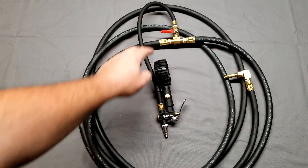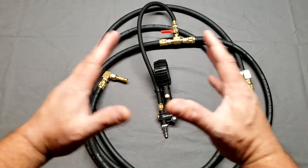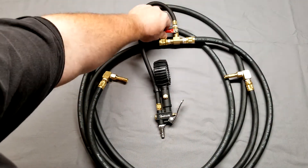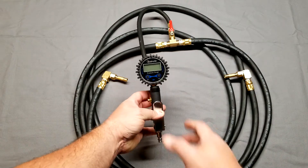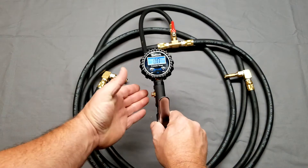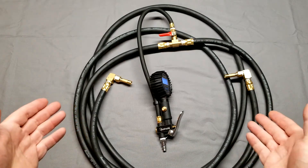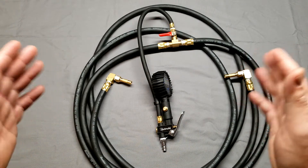These will thread right onto each valve stem, and once you have them on both valve stems with the valve closed, the pressure can equalize back and forth between the two tires without even putting any air in — you can just equalize to whatever pressure it is. If you need to put air in, you just open the valve, squeeze the trigger, wait for the desired pressure, then stop and close the valve. By that point they're probably equalized anyway, but leave it connected to both valve stems for 30 seconds or so for the pressure to fully equalize.